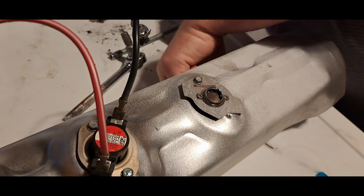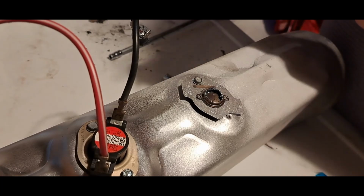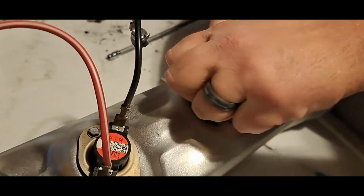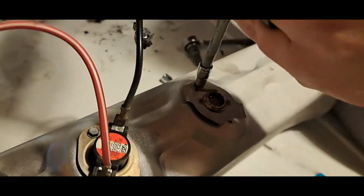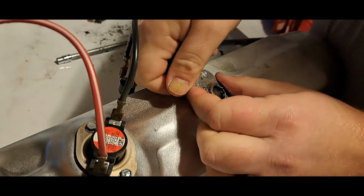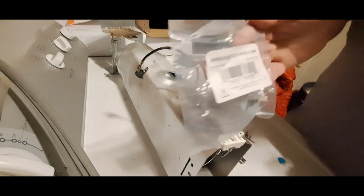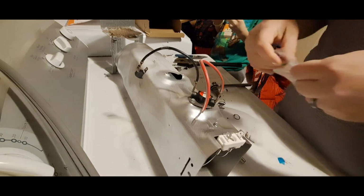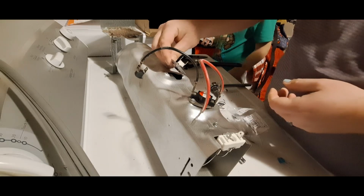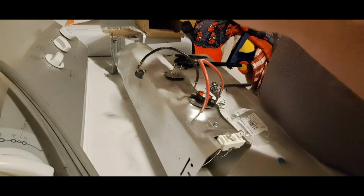All right, thanks to 2-day shipping, we already got our replacement parts. So I'm gonna pop the old dead thermal fuse off. It's that same quarter inch drive fit the other piece used. That comes off. This should now just pop right out. There it is. Now, all right, here's the thermal fuse from Amazon. Crack that open. This goes on super easy. It's just the reverse of the other. Pops right in and put the screw back in.